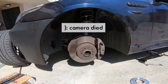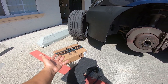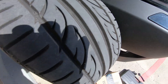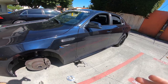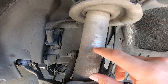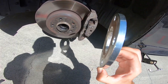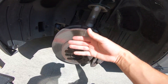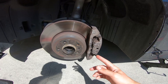Now they're off the car, it's the perfect time to clean the brakes, calipers, and maybe do some painting. The tires are in great condition — they are M-sport. The only thing is they're staggered, which I kind of like, but I need spacers because they're hitting a little bit. I got some spacers but these aren't enough — they're like 12 or 10mm. I ordered 30mm, which should make them flush or even stick out a little better.